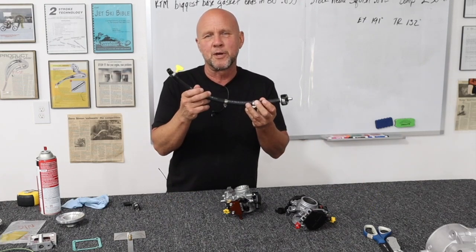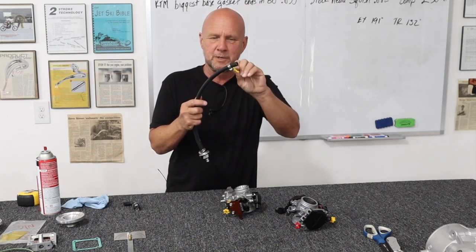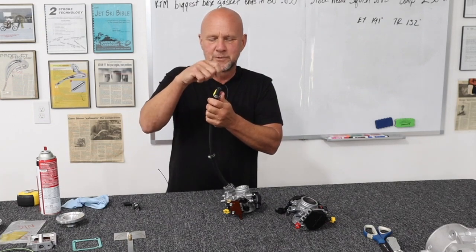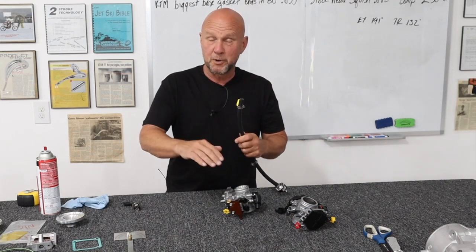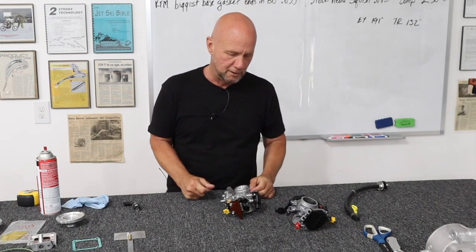You're going to ask, how do you take this part without it leaking? Well, this is only designed for the newer bikes with the pump on the top of the tank. You just use this clamp-on filter and pull it away from the tank. Yes, it has fuel in it and yes, it could spill. If you don't want it to spill, you could just slide a spark plug in it, a bolt. I usually just leave it, keep it out of the way, take the tank off — it's fine. Make sure there's no sparks, because the battery's right there. No fuel really spills out, and you are fine.